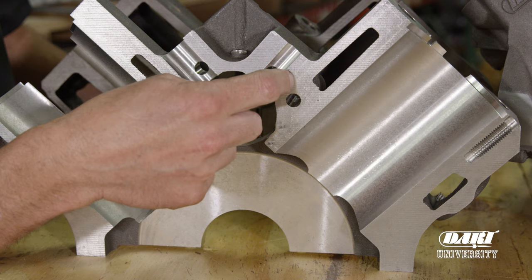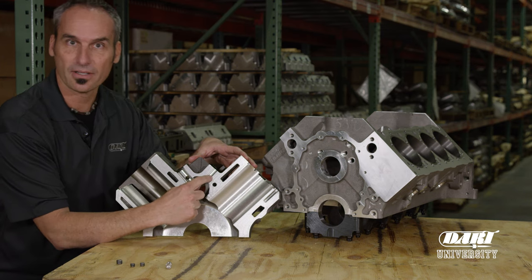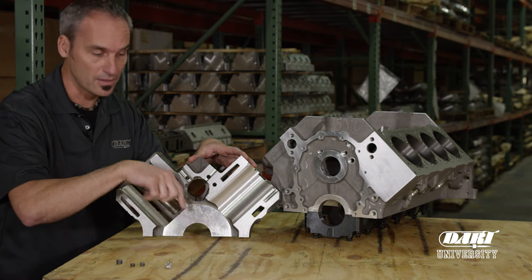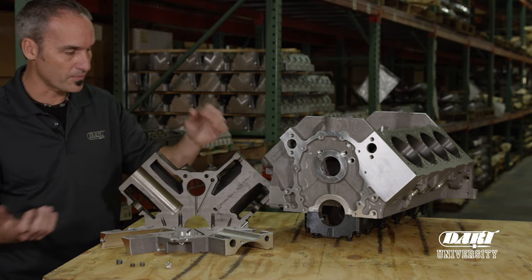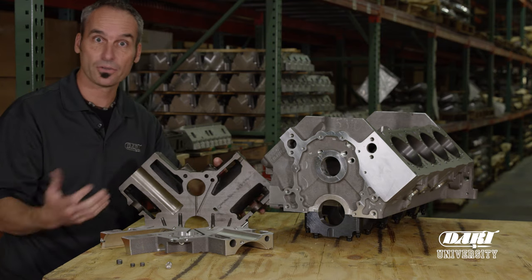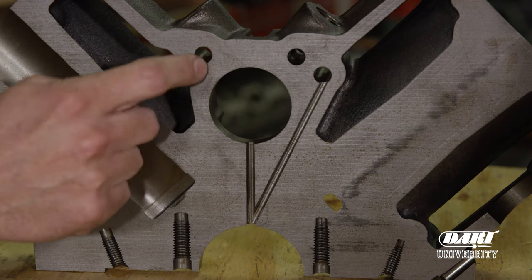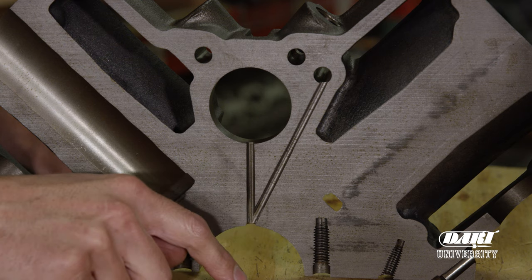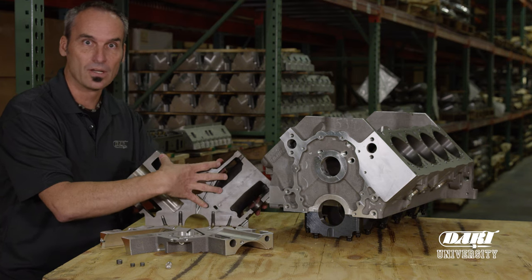An OE block typically might blend some of these circuits together because it's cheaper and easier. Upstairs you've got your tappets, your lifters, your camshaft, and a lot of times that gallery is sitting in a convenient spot to feed all those first and then feed the crank. We talked about the importance of feeding that crank first, so Dart goes through the extra trouble of separating the main oil gallery and feeding your crankshaft first. The crank feeds the rods, then we start feeding secondary needs like your cam and valve train.